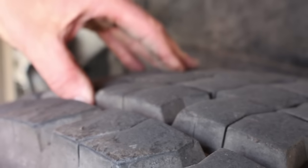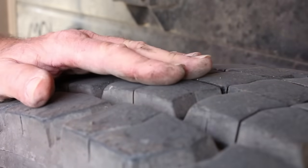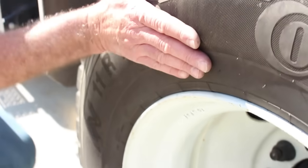Coming up the inside wall of the tire — no abrasions, bulges, or cuts. Inspecting across the top of the rear tire tread: it cannot be less than 2/32nds on the rear tire, and it is worn evenly. Going down the inside of the tire — no abrasions, bulges, or cuts. The bud spacing is where the two steel wheels meet — there is no space between them and nothing lodged between the two tires. A rock or stone lodged there could fly out at higher speeds. Across the top of the outer tire tread — not less than 2/32nds, worn evenly. Down the outside of the tire — no abrasions, bulges, or cuts. I don't hear any sounds of air leaks.